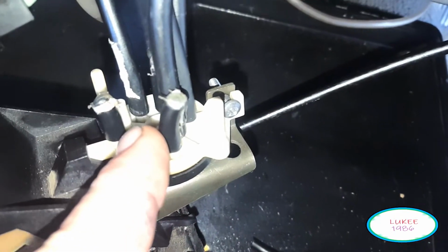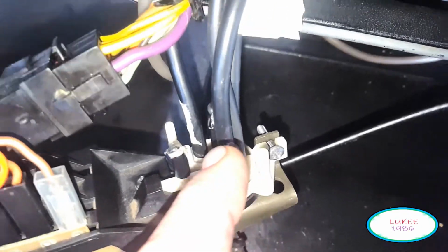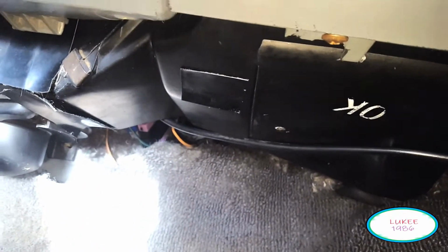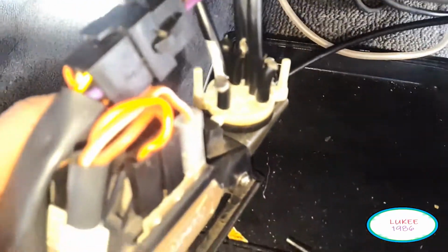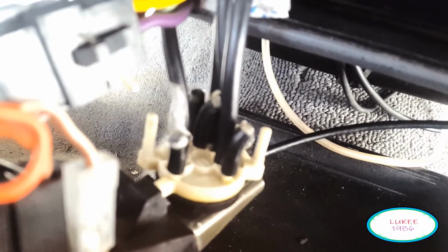It does say in the book, which I will show you later, just so you can work it out, but this is much easier seeing it done. So 1 is covered, 2 is covered with my homemade thingies, 3 is the blower fan, which runs down under the passenger side. It's a little actuator, that little round thing near the orange cord. Number 4 goes into the engine bay, so around the stereo into the firewall. Now number 5, which is way at the back there, goes to that white and black valve, one-way valve I believe, and I'm not sure where that goes to. I haven't looked. I was just hoping that was still connected. 6 and 7 are both covered, they don't go anywhere.